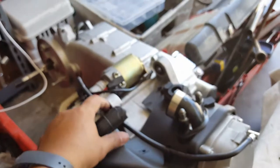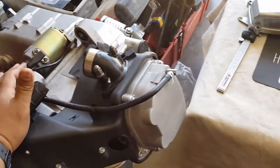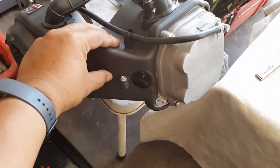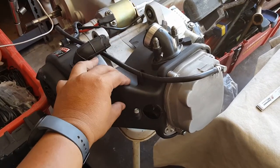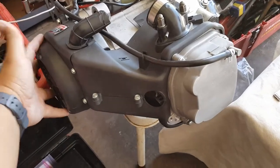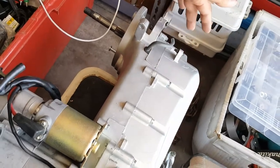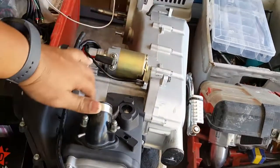Previously we upgraded our 150cc to a 171cc, which didn't require upgrading the starter. But I do recommend if you're going to upgrade to a 180cc, upgrade to a high torque starter, a high flow oil pump, and a heavy duty starter clutch. Those are the three main things you want to upgrade because it's going to take a little bit more power than even upgrading from 150 to 171cc. You're going to use your same stator, same stator cover, same housing, and the same existing CVT cover and transmission cover. We will upgrade to an NCY CVT kit — you'll see that in a little bit.